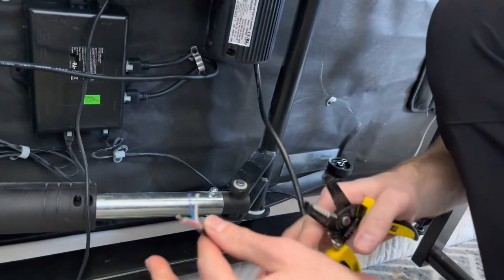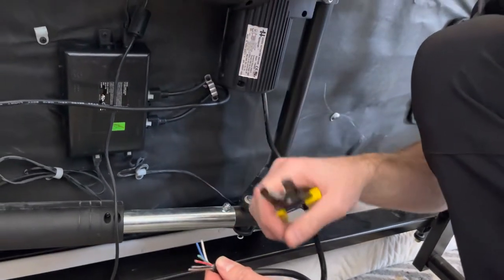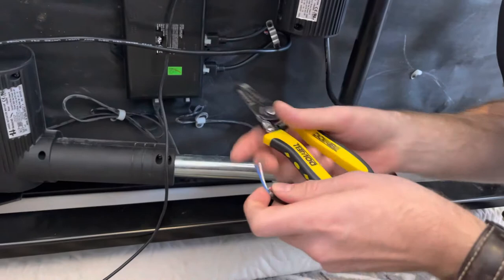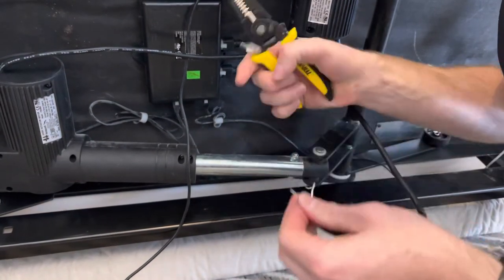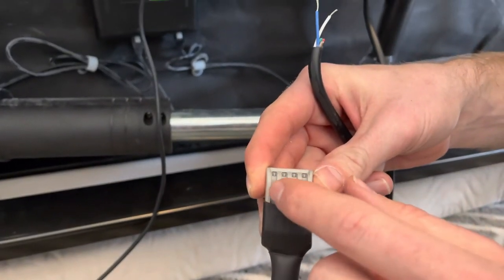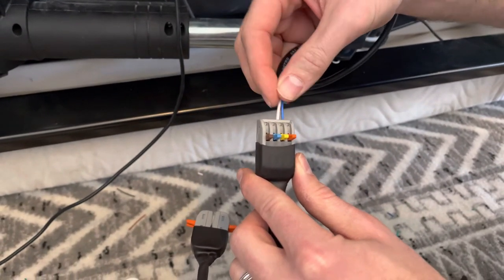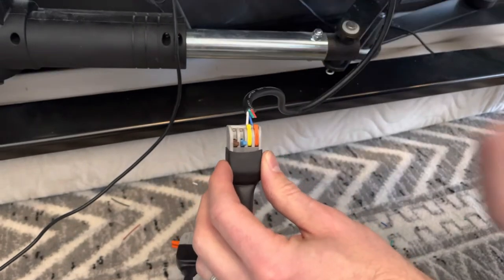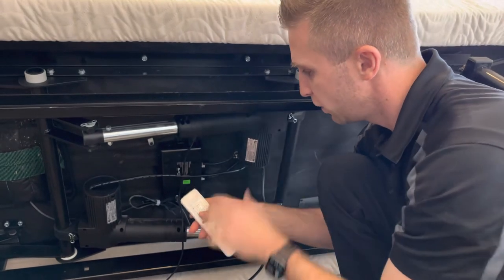Ultimately, if it's not one of the bed bases we've done before, it could be any combination of the four, five, or six wires inside — but only one will operate the motor up and another will operate the motor down. In this case, knowing the blue and white are the wires we need, I'll go ahead and cut off the excess of the other wires, then strip about a quarter of an inch back on each to expose a little bit of the metal underneath. On our universal wiring kit, orange and yellow are the head, and blue and brown are the foot. Knowing blue is head-up and white is head-down, slide those in until they don't go further, clip them down so they're secure, then tap the head button once or twice and you'll hear the motor move.